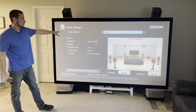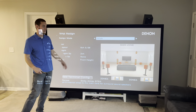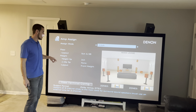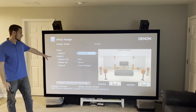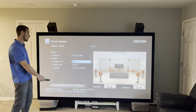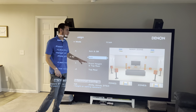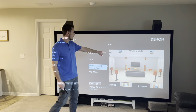In this menu, the first thing is to change the Assigned Mode from 9-channel to 11-channel setup. I've switched it to 11.1 channels, which adds those two extra channels going through the pre-out to the other receiver. Then we come down and change the height layout shown here. We go to the height speaker setting and change it to four. When we do that, it adds those two height channels — it'll pick them randomly based on your previous setup, but there's another setting below where you can change the layout of the height channels.